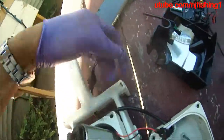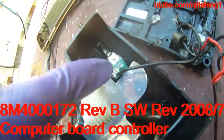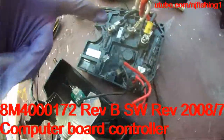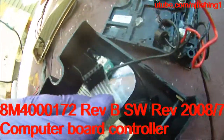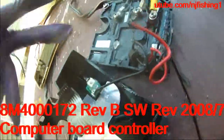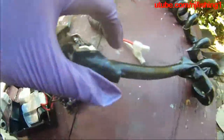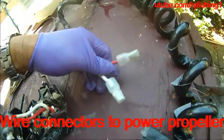I think these two wires connect to these two wires. This black wire is the wire that takes in the wireless signal from the antenna and feeds into this computer board here. This computer board has six pins that deliver different power, and it's actually delivered in this ribbon here. So be very careful when you remove this wireless trolling motor — you do not want to break any of these pins, or when you put it back, you do not want to destroy any of these pins.